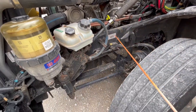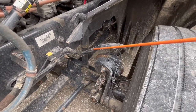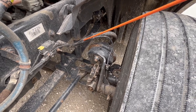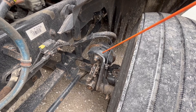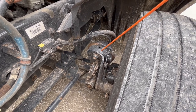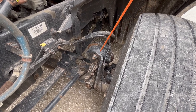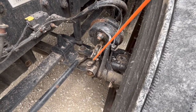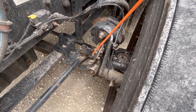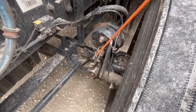As we move back, we're going to do the brake system. Right here you have your air lines — they're properly mount secured, with no abrasions, bulges, or cuts, and they're not leaking. You have a brake chamber — properly mount secured, not cracked, damaged, or leaking, not missing any nuts or bolts. Slack adjuster and push rod are properly mount secured, not cracked, damaged, or bent, and have no more than one inch of play by hand with the brakes released.